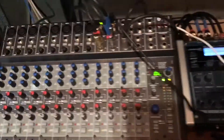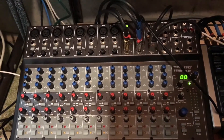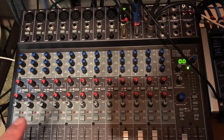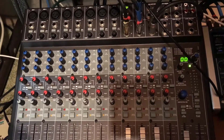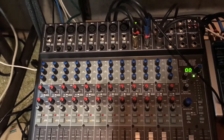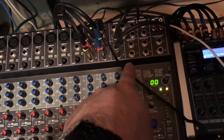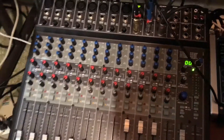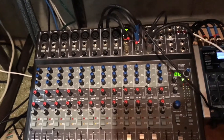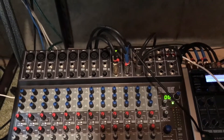Going back to the Roland V-Studio's audio — it's really good. You'll often see them for dirt cheap and some channels aren't working because the power supply goes out. All you really have to do is replace the capacitors, which is a really easy fix. I was able to fix all the channels and got a really decent digital mixer board. However, there's a bug where one stereo channel doesn't work due to the drivers — they stopped supporting drivers for this unit. We've been able to make it work using drivers from a different model, kind of a driver hack.